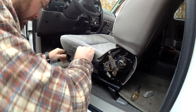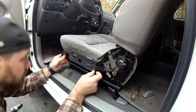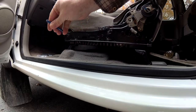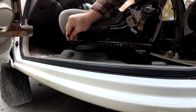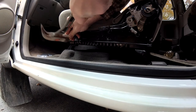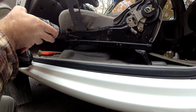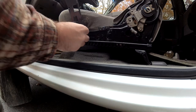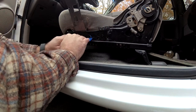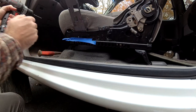The big thing is having this level before you drill the hole. I'm going to take a little punch and make a nice mark here so the bit doesn't walk around on me. I'm gonna put the bracket right in there to keep from drilling into the seat. Mechanic John recommended putting a little piece of tape here to keep shavings out of your seat track — I think that's a great idea.